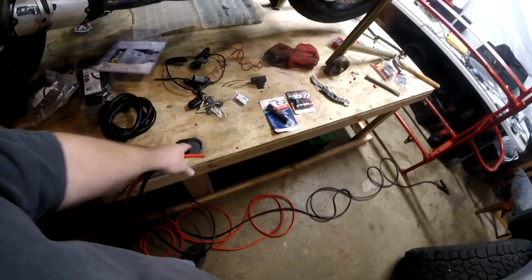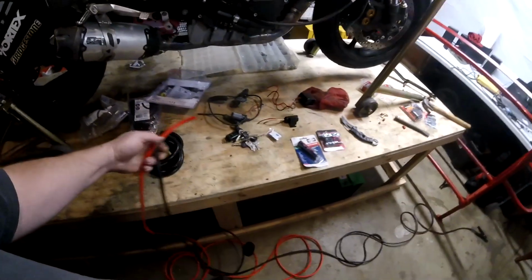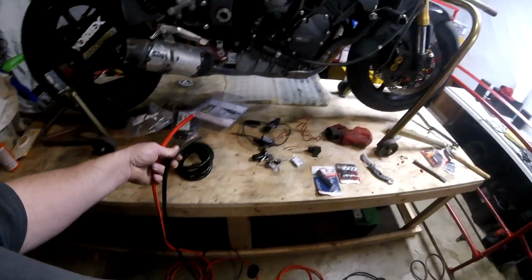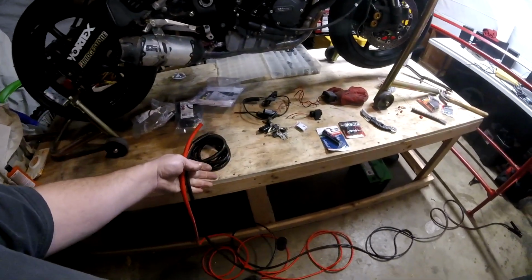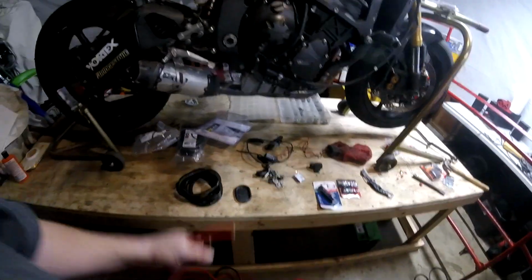I'm going to start drilling holes, running this insulation together. This protectant will only go over the red. It doesn't need to go over the black, because this is ground. If it scrapes on a frame, I'm bolting it to the frame anyway. So I'm going to put the protector on the hot side, get this all wound up and loomed, and run through this thing here, grommeted on both sides, and ready to push it up through the floor, and I'll come back. Hope you don't miss me.